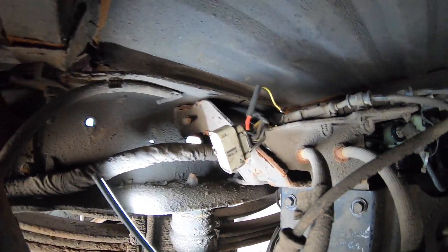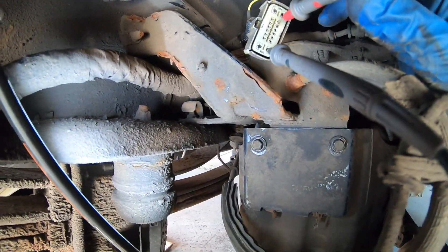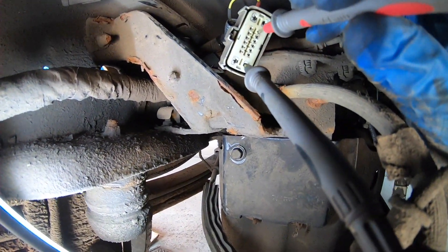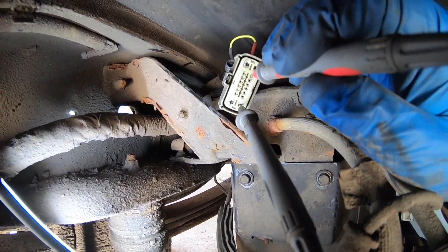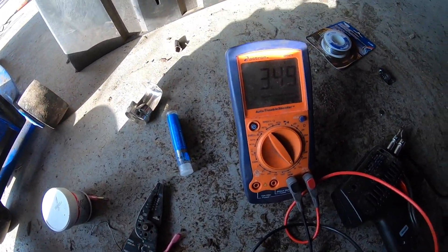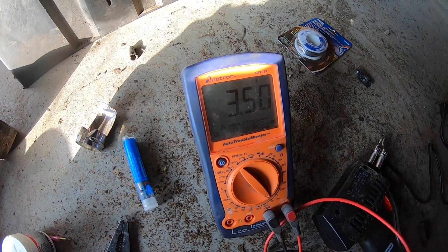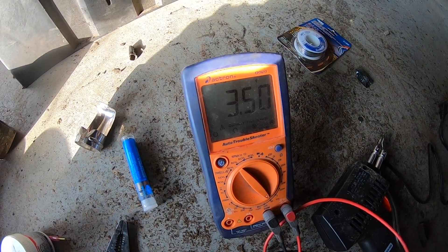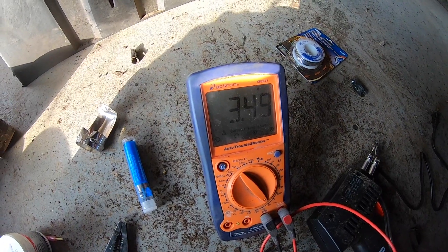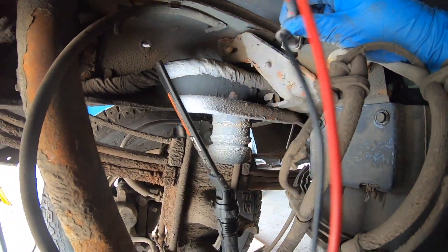We're back — I've got the multimeter, checking it while I'm down here. Black pin in ground, red pin in the wire pin. Looking through the back of the connector — we've got three and a half volts, wiggling it around — 3.9 volts — holding pretty steady. That seems a lot better. I'm going to plug this back in and go check the check engine light again.